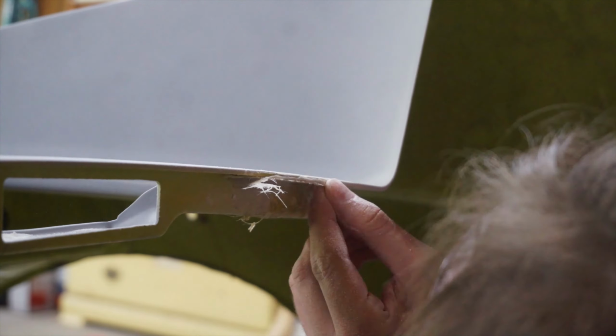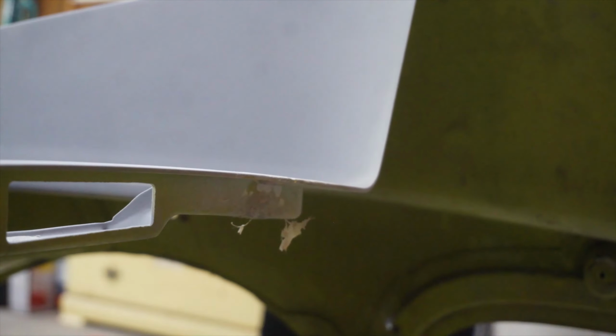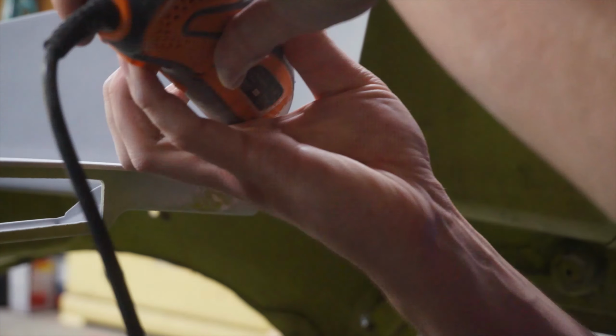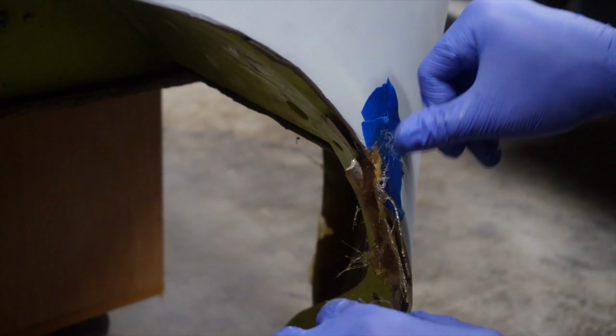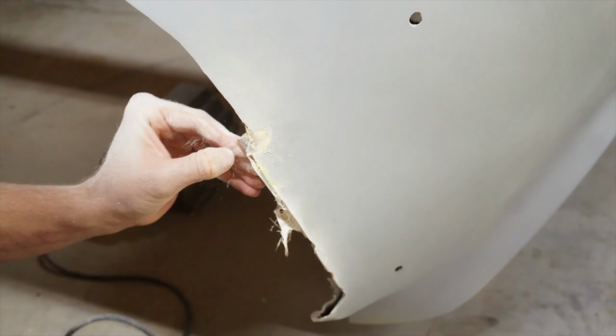I used the sanding block and tape to keep the very thin repair area flat while it dried, because the room for error on such a thin piece is extremely slim. Also bear in mind that the two diffuser mounting points underneath the rear clamshell required some off-camera work, because it's very difficult to film while attempting to manipulate the fiberglass in place.